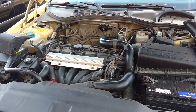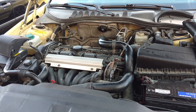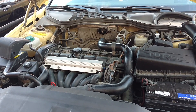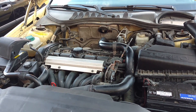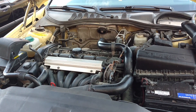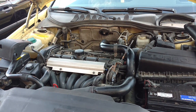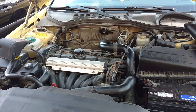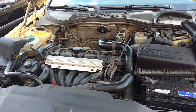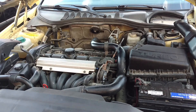In this video, I want to tell you to simply check your turbo piping. It all has to be checked by hand, very carefully. You just can't skim over this. If you're having problems with your car running properly or boosting properly, you may or may not get a code. If you don't get a code, it's either fuel pressure related or it is probably a loose pressure tube somewhere or a loose vacuum line.